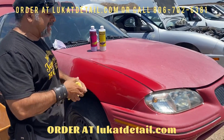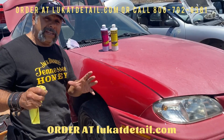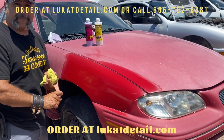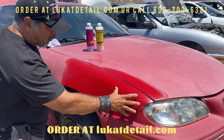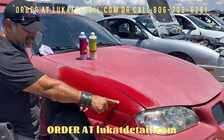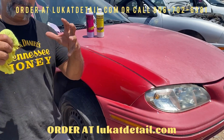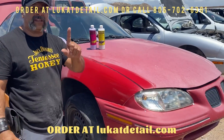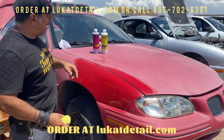Now, here's where you guys gotta understand, this is not detailing. Now you can go buy a really nice fancy wax. Those ceramic products, the synthetic products, all that stuff, and it'll work because this paint is smooth and glossy again. You never want to wax a dirty paint job because you're going to mask and trap the dirty stuff that's eroding your paint. Fix it with this. You only have to use this once every 5 or 10 years, if at all. The cleaner removes the buildup, the wax seals it.